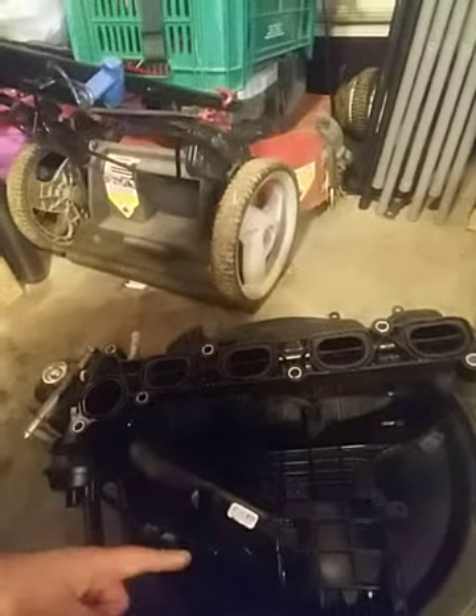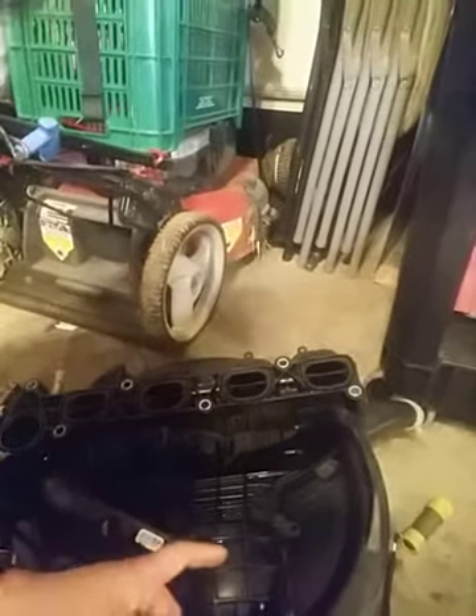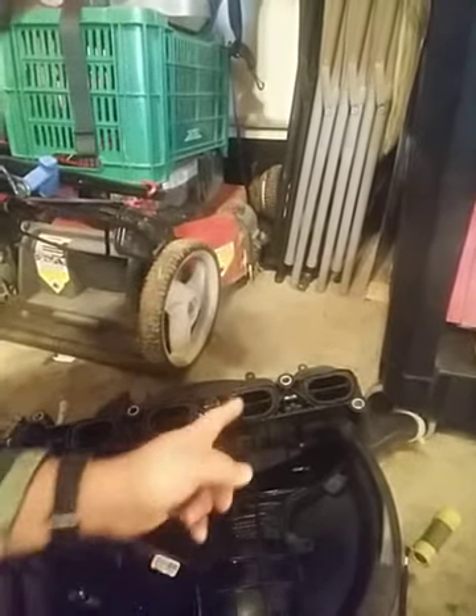In the plenum, the path of least resistance is cylinder two. Looking at the back side of the intake plenum, this is where it hooks up to the tube on the PCV valve, and where the direct air flows in — it flows directly into cylinder two. That cylinder two misfire is where everything started for me. I thought it was an intake leak but it was not — it was actually oil coming in from inside the EGR pipe and the throttle body, taking the path of least resistance which was cylinder two.